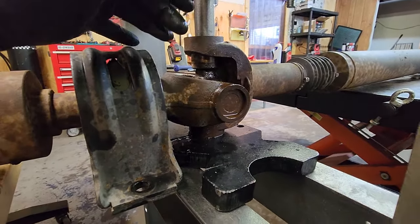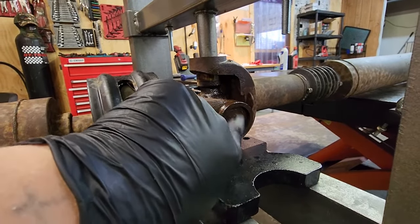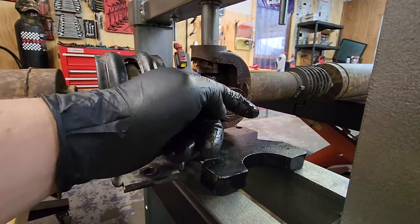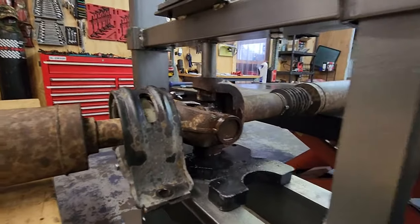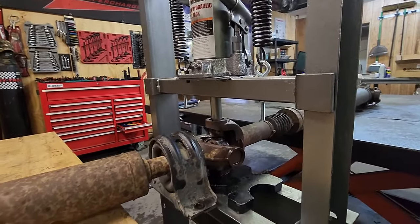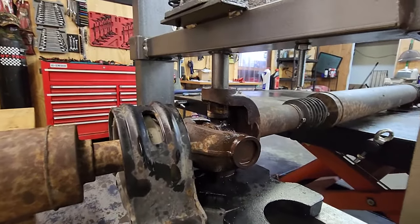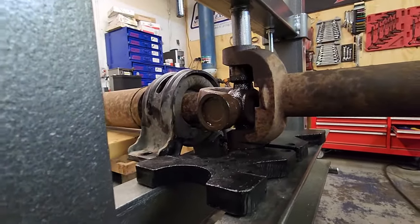Then you can remove the entire joint. You can do that with a hammer and sockets — just make sure you've got the right socket that fits, because you're pushing on the inside of this, not on the outside. You obviously have to have something on the outside that fits around this radius so that when you're pushing the caps, the cap can come through and not catch on whatever tool you're using. We're going to start pressing — I've already started on this one. It'll build some pressure and make a little pop noise. There you go — see, it just moved a whole bunch right there. WD-40 or PB Blaster goes a long way when you're doing this. This one's just about completely through on the bottom side.